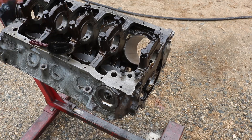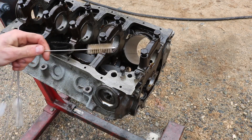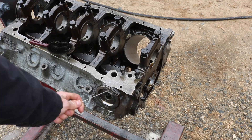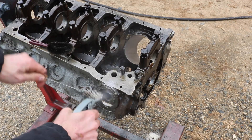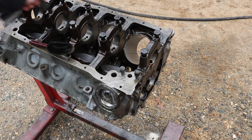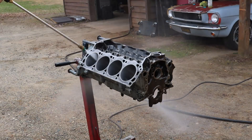While cleaning, you'll also need some of these nylon brushes — I'll use these mainly on the crankshaft. For all the holes in the crank when you clean it, you soak everything up and stick these brushes into every hole to get every little bit of material out. Same with the block — every hole you can get to with these brushes, clean it. Use the microfiber inside the cylinders. Now I've got the engine all scrubbed down for the first time and holes cleaned out, so I'm going to go ahead and pressure wash it to get all the big stuff out, then soap and scrub it again.